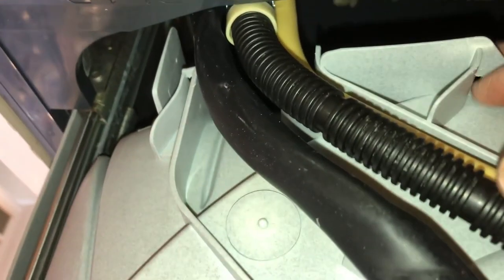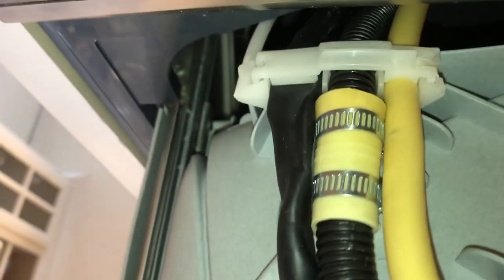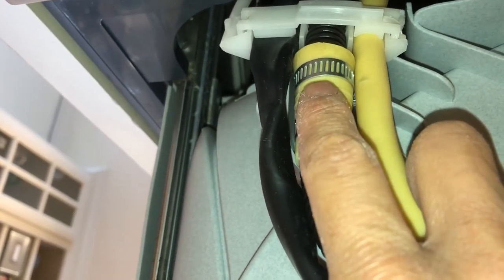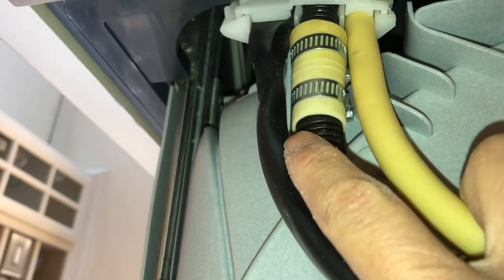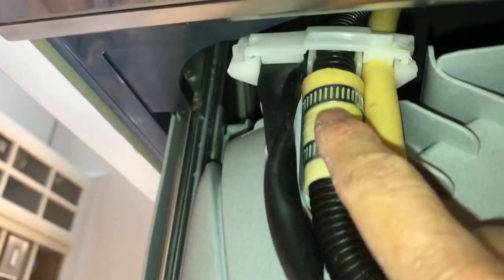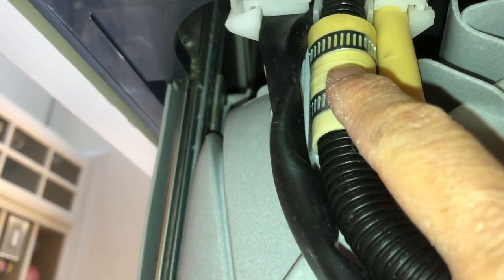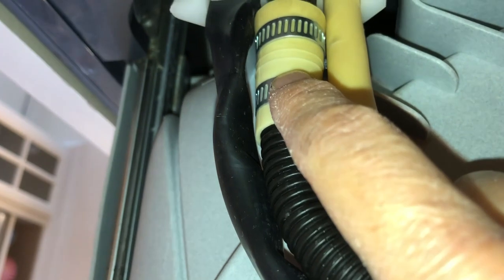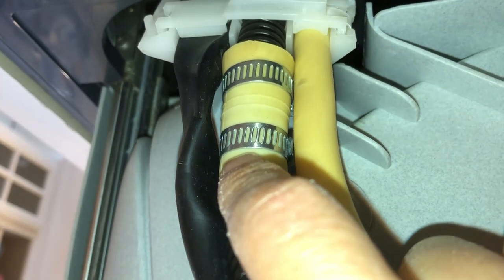This is a very tricky angle. I'm coming underneath, looking towards the back, and I'm going to pull this drawer out and then pull these cables out here. I've already temporarily patched this here. The problem is that this cable right here bends at 90 degrees every time you open and close the drawer — this is where the water goes out and it puts a lot of strain on this connection. Eventually it will start leaking on the top or bottom side, and eventually it's going to break and that'll be a real gusher. Fortunately I caught it while it was still just a little bit. I put this clamp on here, but I'll show you the video of what happens when you open and close the drawer.